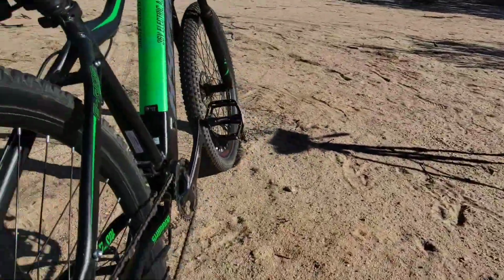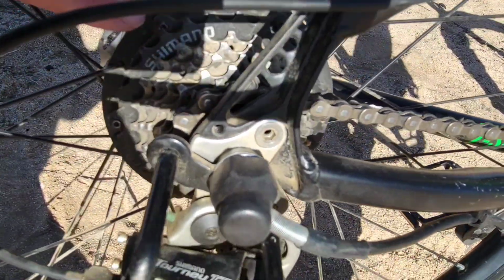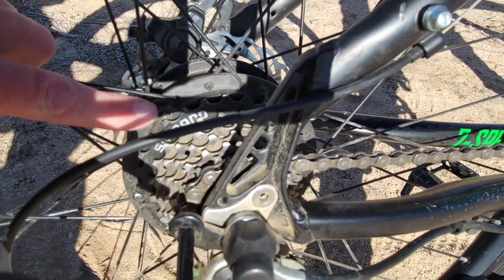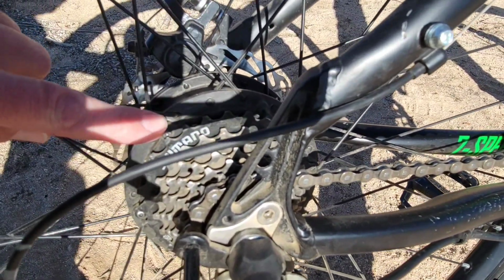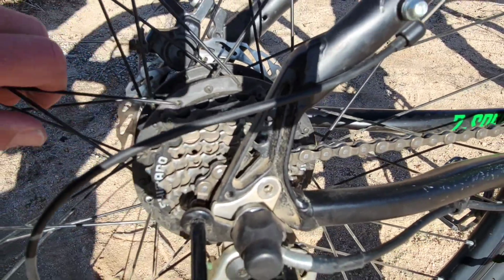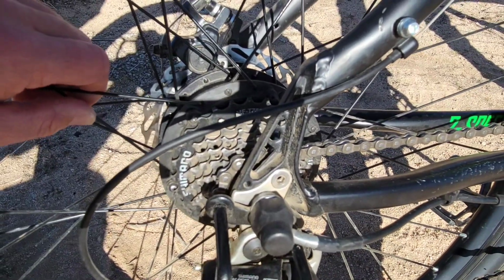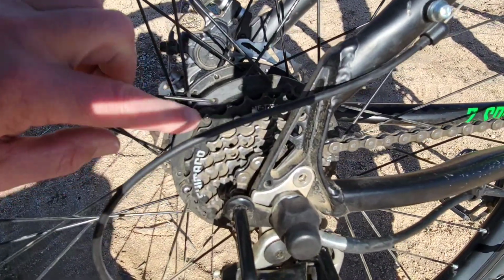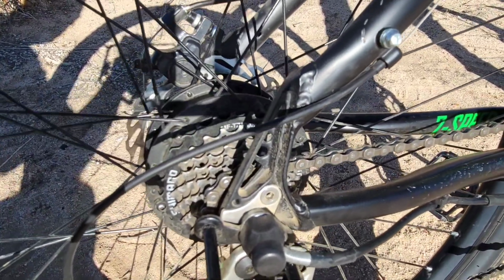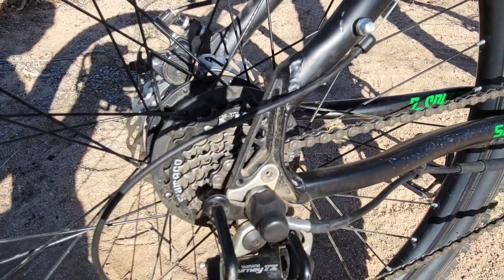And the worst thing about it is, let me get back around here. See on the motor, these little screws that go all the way around? I was riding my bike, and I thought I broke my freewheel, because I was pedaling and nothing was transferring back to the back tire, and I stop and look, every one of these bolts were gone. The motor was split, and I ended up having to push it home.